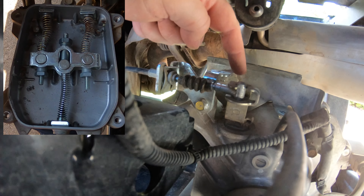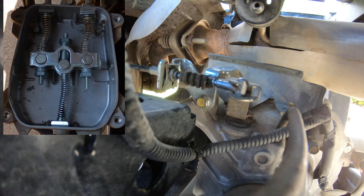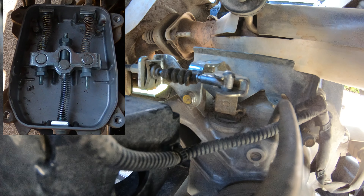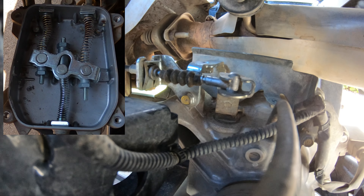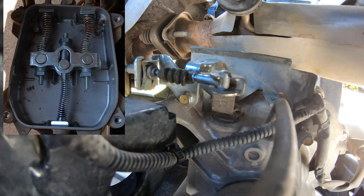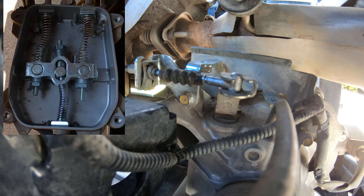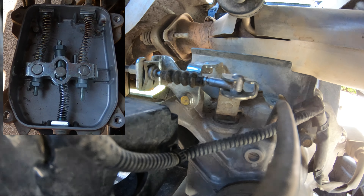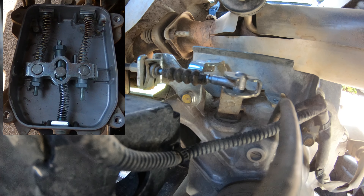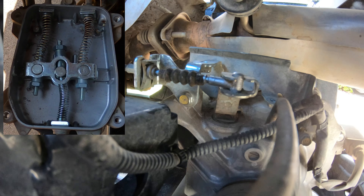The cable aligns the rear differential to either unlocked, locked, or park. We'll go from turf mode to two-wheel drive, back to turf mode, back to two-wheel drive, and now to park. As you can see, there's a three-position cog inside of there — turf, two-wheel, or park — and the adjustment of those three levers controls how much this piece moves back here on the rear differential.